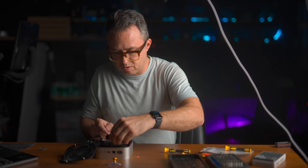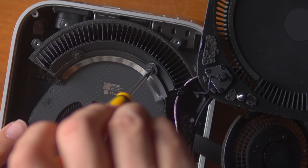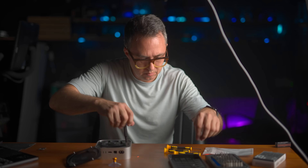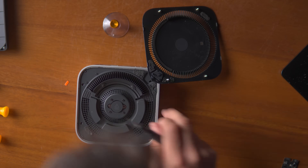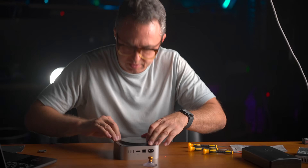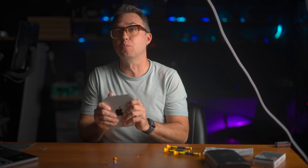Flip the fan back over — it'll land right where it needs to go. Super tiny T3 fan screws go back in, then back to the T5 screws for the larger layer. That layer flips over. Count all eight screws going back in — I almost left the eighth one out. Then the bottom plate has little pegs that, if you put it in the right spot, go back into their holes and snap in. Better than new — bottom plate snapped back on and we are just one system restore away.